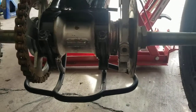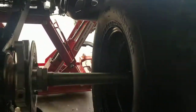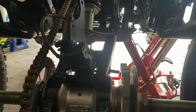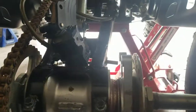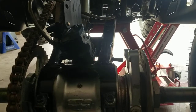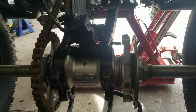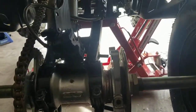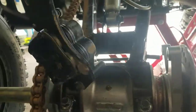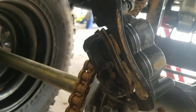We're back here today with the Tornado. After my pros and cons video I went ahead and washed it. I might be taking it out today, but I decided I've got to change the brakes real quick again. Like I mentioned before, they're a little worn out — definitely down to the metal after a couple of rides. I was a little rough with it, so I can see why. These brakes are not the easiest or best. You can tell the pistons are fully extended.